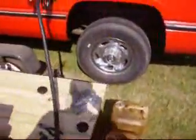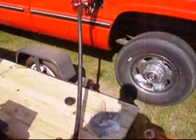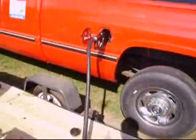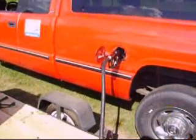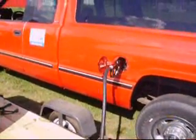As you can tell, there's no exhaust smoke coming out of the exhaust system. Keep in mind the truck's burning 70% used oil. We tend to notice an increase in fuel mileage — typically this truck gets around 3 or 4 miles per gallon better, and a little bit more horsepower as well.